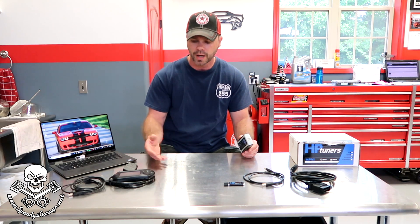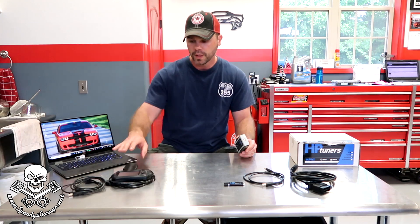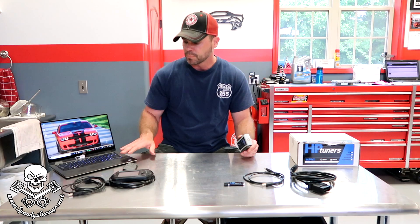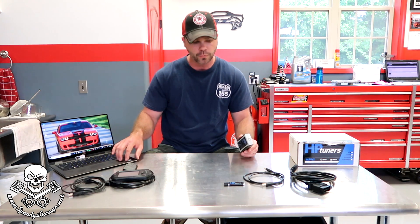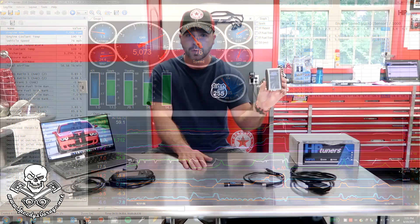Also you don't get the tuning software with the Diablo tool — you get a very small amount of adjustment, I think it's 10% either way. For example, we're at the track and the air/fuel is 11.0 and that's too rich — you've only got 10% of adjustment either way rich or lean when you use one of these tools, so a little bit limited there. If you buy the full software package to go with the Diablo tool I think it's like $2,500 to $3,000 — it's called CMR — so most of the time only a shop would spend that kind of money to get that software package that's already included with the HP Tuner module, which is called VCM Suite. It comes with the tool all in one package — very nice.